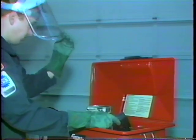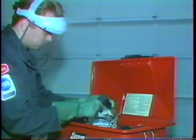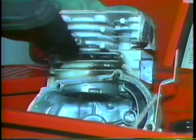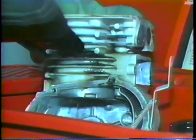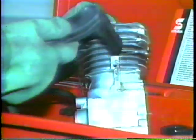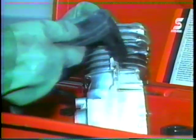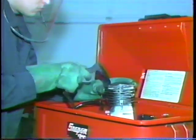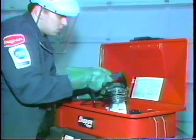If the cylinder block and crankcase cover are coated with a heavy layer of oil deposits, wash them off in a cold solvent tank before beginning. Removing this grime will allow for easier inspection and a more professional work environment. For now, simply remove the heaviest deposits because your inspection may find the block to be unusable in the rebuild.